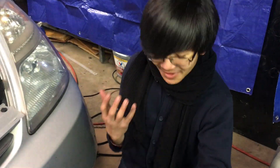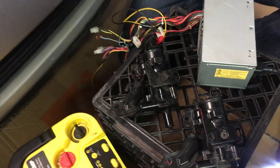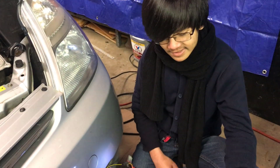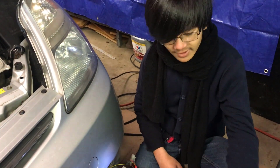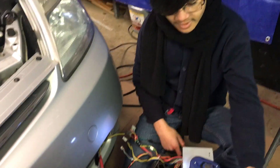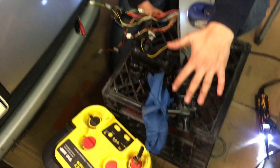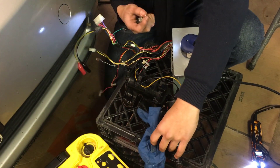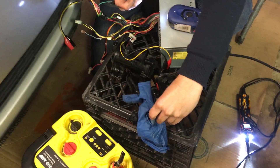It's less — it's less powerful. So now we're going to test the suction. When you're testing a dry motor like this, you don't want to test it for more than 30 seconds at a time so that it doesn't overheat or burn. And when you do, you want to leave it for like a minute so that it doesn't overheat before you do it next time. So we're going to cover it with something to see if it changes the sound.